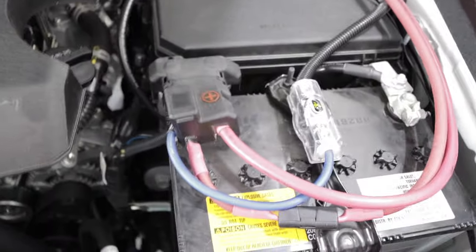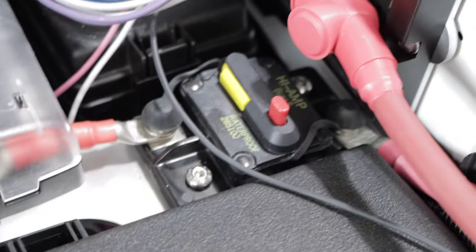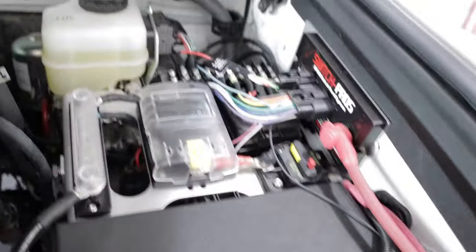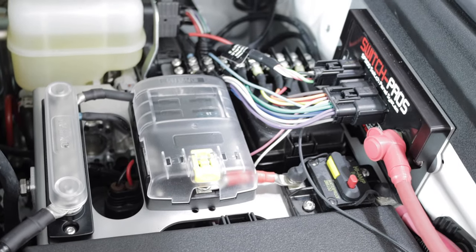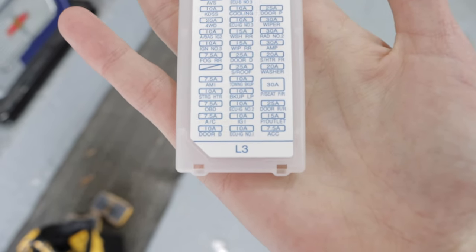Opening up here — we ran two power cables: one to the circuit breaker and one to the actual Switch Pro. We've got ground from the fuse box to the bus bar, and then ground from the bus bar to the battery. The black wire from this big mess is ground to the firewall. The blue wire — we figured it out. Being a 2021 4Runner, we tapped it into the bottom one that says P/outlet, second from the right, with a 15-amp fuse. I went to AutoZone, bought the 15-amp fuse, tapped it into the add-a-fuse, and it works.